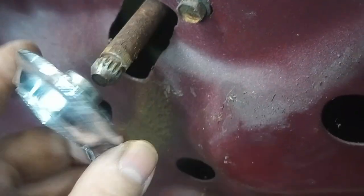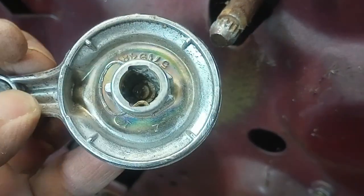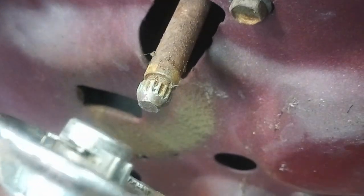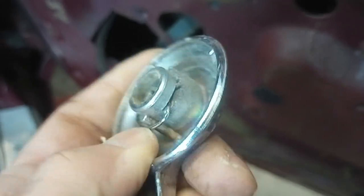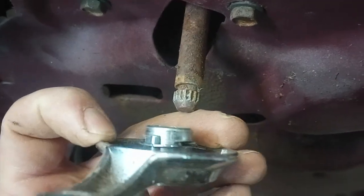And then the trickiest one is the window vent, and it's not even that hard. It slips on a spline shaft, but it's got a clip and you've got to orient the clip so the hoop is facing up. It's kind of like a spring clip — you can see the little tabs go in there and engage with this groove to hold it on. Pretty simple. I just reached in there with a little hook tool and you just pull it out, yank it off. I put the clip back in there so I don't lose it. It'll probably be a little tricky getting it on, since you've got to squeeze it in between the door panel and the little trim piece, but probably just get a small pair of pliers and pop it down there.